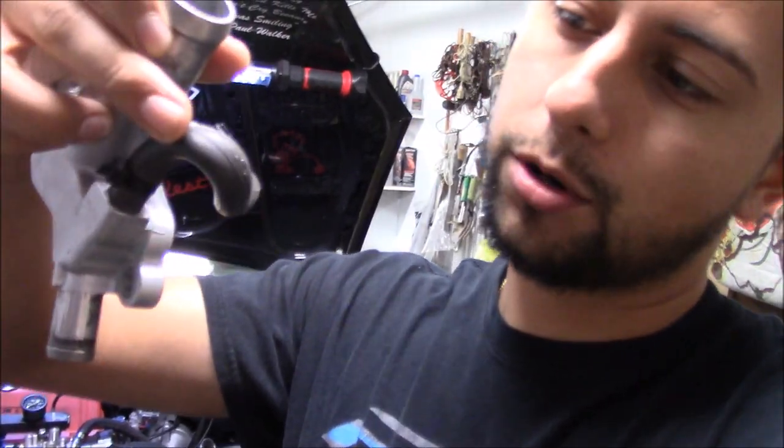We're gonna really fix this the right way. I'm pretty sure if I left it just looped with a proper hose it'd be fine, but I like things done a certain way. So I'm actually gonna send this to a shop — one of my buddies, Top Secret, the shop where we got the car dyno tuned. He's just gonna throw a couple welds in these little ports. He's probably gonna weld this up for me and make it permanently shut, because I don't use those ports anymore. Those ports were for when you had the factory throttle body, to help warm up the idle air control valve on cold starts. I'm gonna take this hose off so you can see, but first I need to send him a picture so he can let me know how much it is.